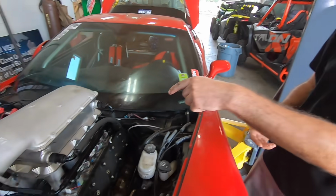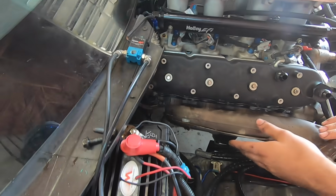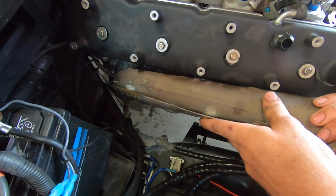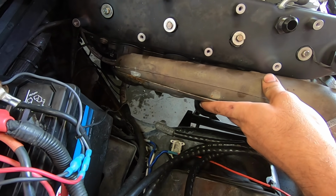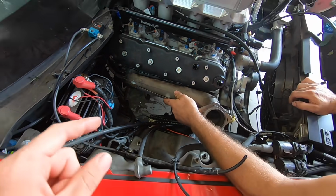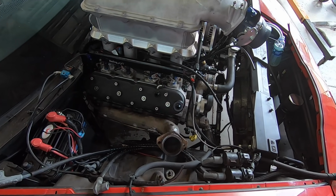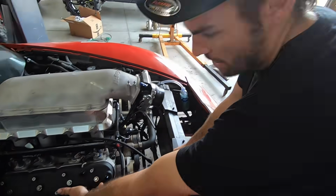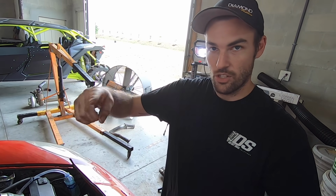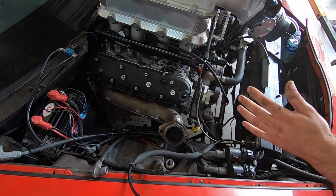Yeah. And then on the other side, it being a flip manifold, clears the lugs. Yep. But here, pull it out of the way real quick or flip it up just so they can see those gears. Two bolts in it. Oh, okay. The undersides of these are hitting the tops of the head studs being a bigger diameter. Yeah, so this side looks like it tightened down, but it would get close and then just start to come into contact with those bolt heads, and it's only hitting two. So this side, you know, with the sitting there grinding it, making a little notch in the header tube, yep, on the cast manifold would clear the tips of the studs and bolt up no problem.